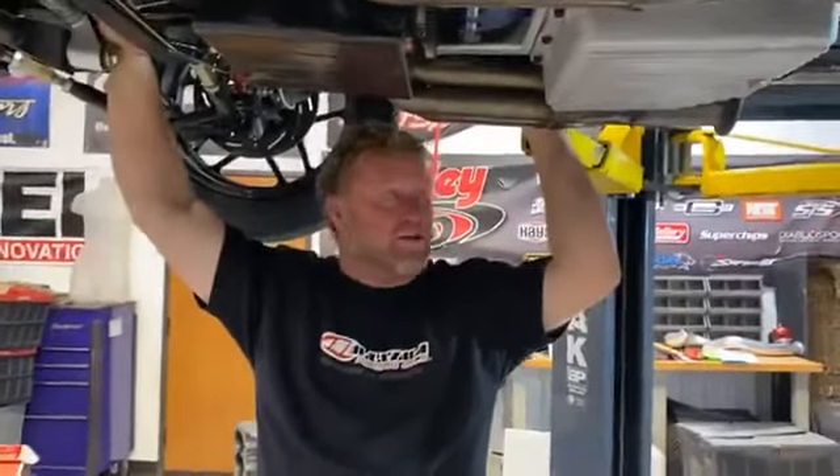Question: are the driveshaft lengths also different between the 400 and the 350? Yes. How much does the Turbo 350 cost from ATI? That's what kind of shocked me — these Turbo 350s with the good sprag, the SFI case, and all that, retail is almost $3,800 to $3,900 brand new with an SFI case. That's pretty reasonable. They built these cases to appease the street car guys and bracket guys that want that extra gear, and we're going to see how much power this will hold.